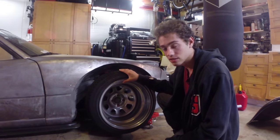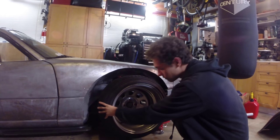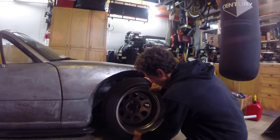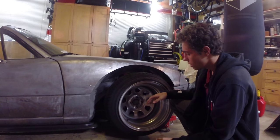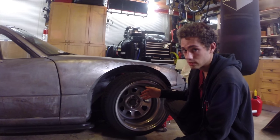Now that we have the car jacked up — since this is the front wheel and there's going to be play side to side from the steering — we can go ahead and test it by going up and down. As you can see there is no play whatsoever, so for as long as I've had these wheels it hasn't affected these wheel bearings at all.